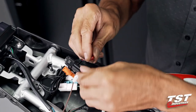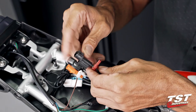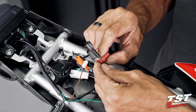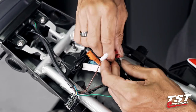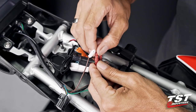On this particular bike, the green wire is the ground and the black wire is the positive. We're gonna connect the license plate light into the wiring in that scheme, and then test it, make sure that we got it right. Now that these are seated down, as you can see, I staggered them so they don't bulk up too much. I'm gonna remove the small cap.